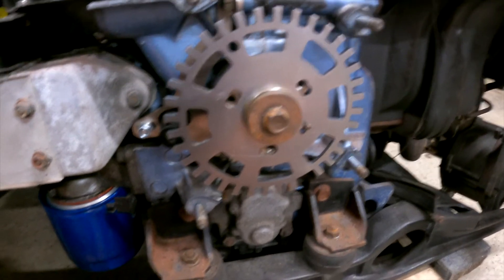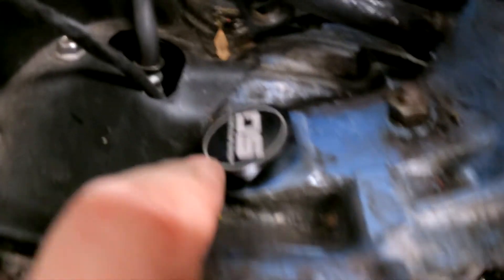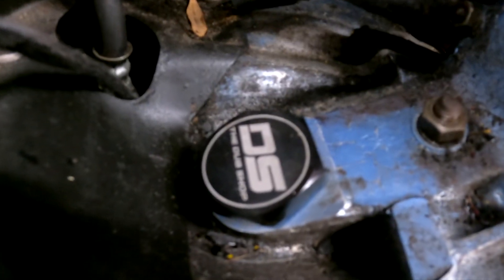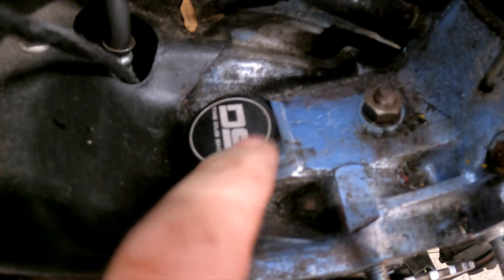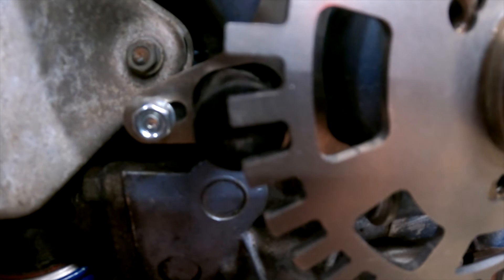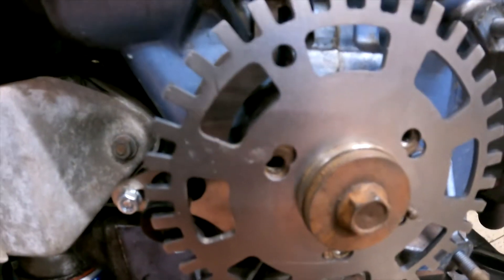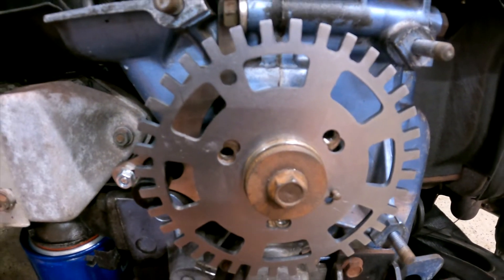And there it is — the Dub Shop Type 4 crank trigger installed. I've temporarily wrapped some cloth tape on here and routed the wires up through my oil pressure sensor hole. The other part I didn't show is the distributor plug — we're going totally distributorless. I cut a little O-ring piece, removed the clamp, and it just sits right there. So I've got my air gap set, sensor in the all-the-way-forward position. Now I need to get a battery, meter, and alligator clips to bump the motor over and verify we're getting a signal.